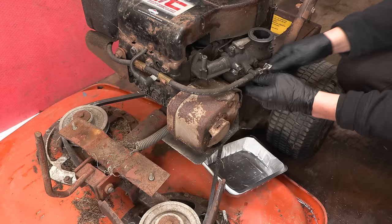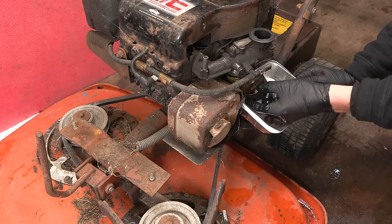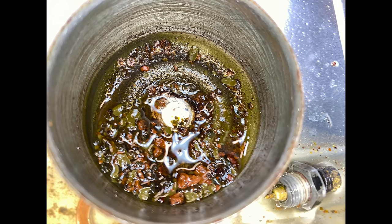Okay, this nut seems to be a bit snarled as they sometimes are. There may well be water in here. Oh, wow. Okay. Yeah, so that pretty much tells us why it's not working. Yeah, so as you can see, we have a rock pool in there, in the bowl, which should be perfectly clean. It looks like that is rust, which has come from the bowl itself, most likely. It's most likely been sat with water in the bowl, and it has corroded.